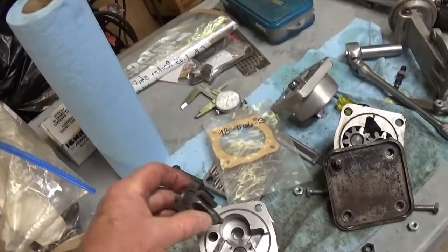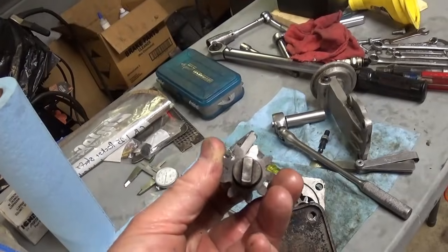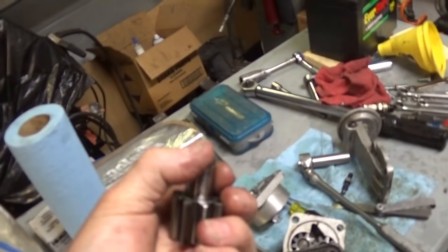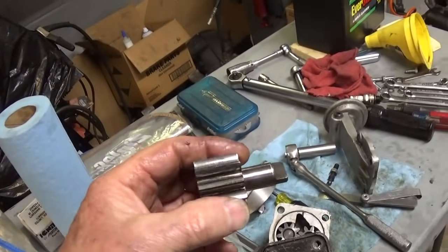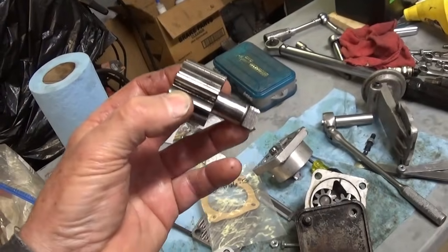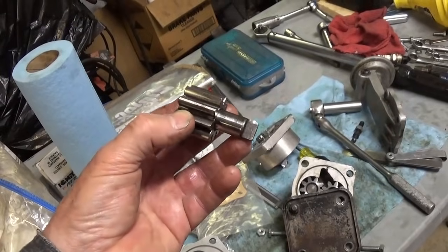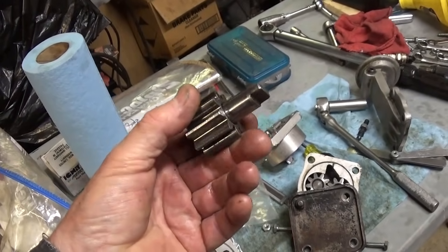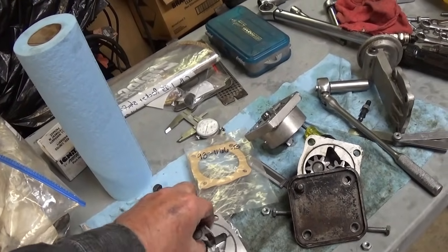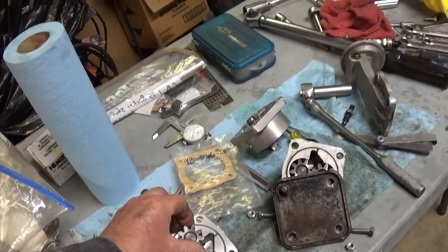The end of this shaft can be adjusted - it's just press-fit on there, you can push the shaft out over a vice and tap on the end. You should measure it. These are all things that come into play when you're being careful building an engine - this is what blueprinting is about, trying to make it to the specification the original designer asked for. When they mass-produce this stuff it gets close, they spot-check, but it's not perfect.